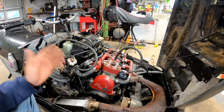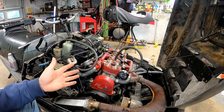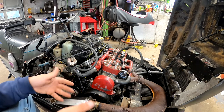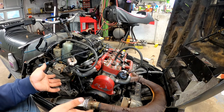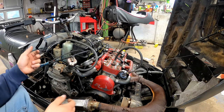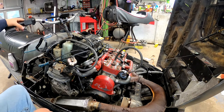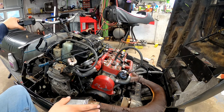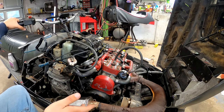Cold engine — I prefer a cold engine because you want to know what it is on the low end, and it's always gonna be higher when warm. You want to know what it's gonna be on the cold side of things. You always do wide open throttle; that lets the most amount of air in. Some say it makes a difference, some say it doesn't — that's just how I do it.